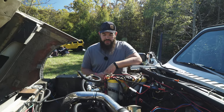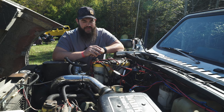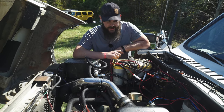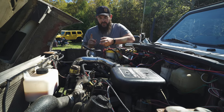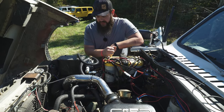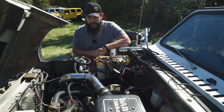This is a 6.2 diesel with a Banks aftermarket turbo. I have a liquid propane evaporator solenoid here that goes into the intake. It's not a night and day thing — it's not like nitrous in a gas engine. It just helps the diesel burn efficiently and get all the available power out of that burn, just maximizing an arguably underpowered vehicle. This is a true one-wire diesel — no EGR — military Humvee intake to get rid of the EGR and the need for any electronics. I run an ECT recycler, Optima 31 series battery here. Back on the frame is the exact same battery mounted above the frame for a dual battery setup. Nice big three-core radiator, electric cooling fan, so I don't have to worry about a de-clutching fan or anything.